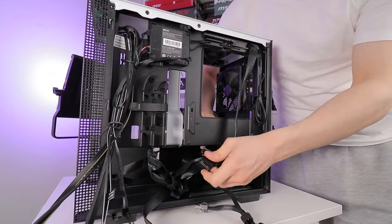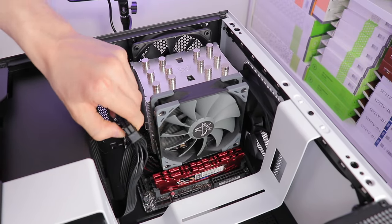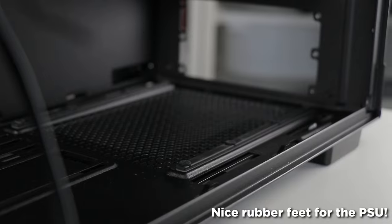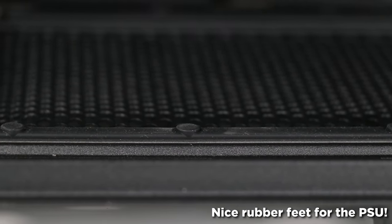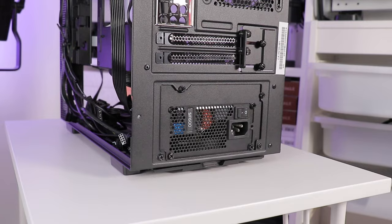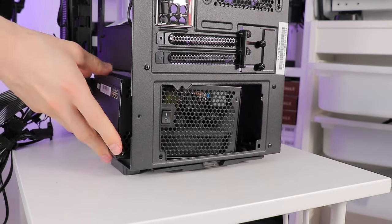Adding the motherboard — the motherboard 24-pin cable doesn't fit. So we're left with a few choices: buy an extender for the 24-pin connector, buy a longer 24-pin cable overall, buy a PSU with a longer 24-pin cable in the first place, or swap the SFX PSU for a full-fat ATX PSU. If you already have an SFX PSU, you'll probably need an extension cable. Buying new? There's no real good reason to go for an SFX PSU for this case — they're more expensive and a little more awkward for this case in particular.